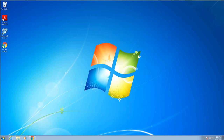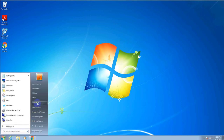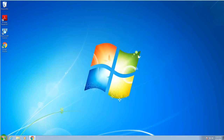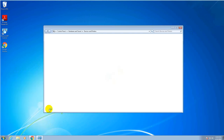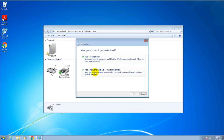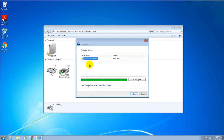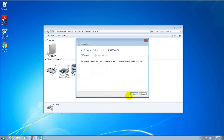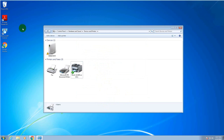I'm now on a Windows 7 machine — Windows 7 Pro. Go to Devices and Printers, click Add a Printer, and choose Add a Network Printer. There it is — the Ricoh printer appears right away. Click on it and click Next. It connects to the Print Management service and downloads the driver to install the printer.